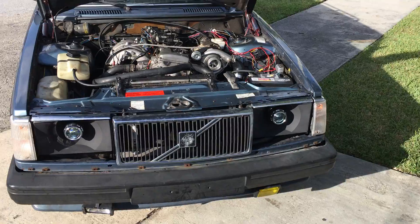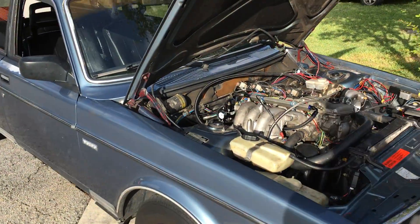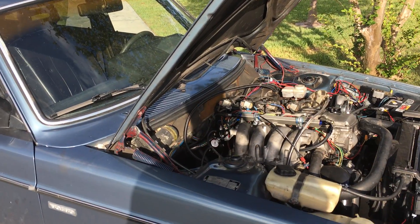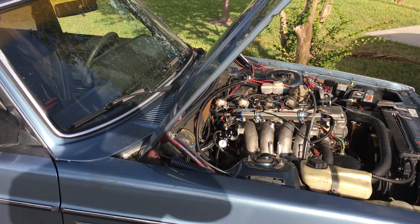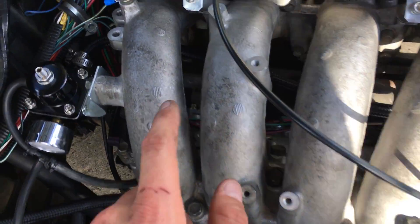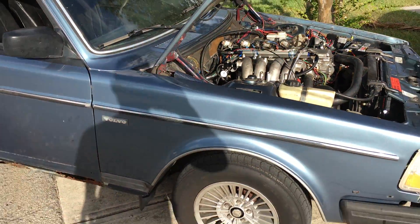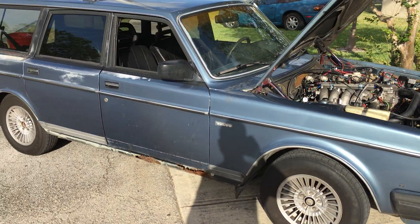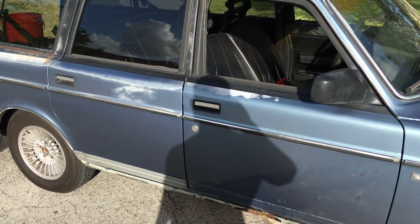I did the headlights. They might look silly, but God, are they effective. We can see the Chinese regulator — 42 pounds. I just wired up the tachometer and the idle valve. Down there, he just gets power and ground and he works. As the temperature rises, it restricts or gives him more air.